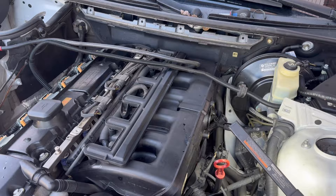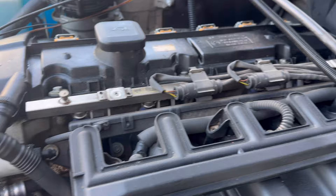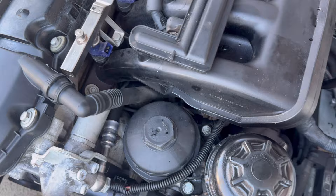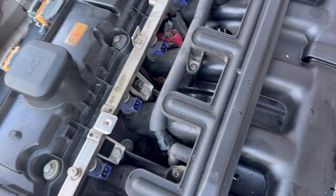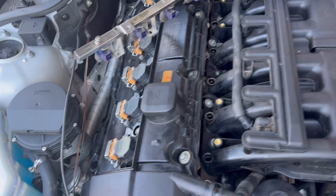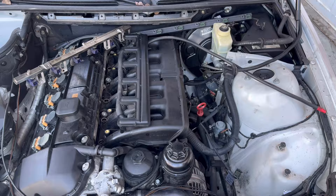Let me get the lower bolt out, then we'll tackle the last little bit up top. Once the injector harness is out of the way, it's really easy to see. Got the injector harness off — see a little bit of mouse evidence in here, but other than that everything's looking pretty good, no real surprises. I'm going to pull the fuel rail off, just undo the rail and lift the injectors up out of the manifold. Got the fuel rail out of the way. Got all the fasteners out that hold the intake manifold down — we're ready to pull it.